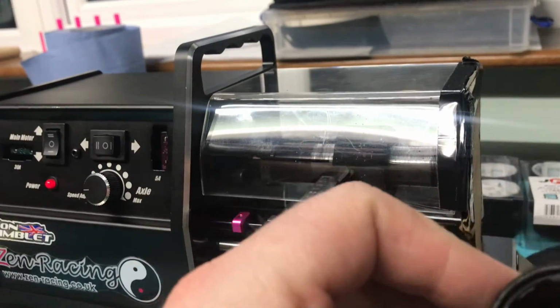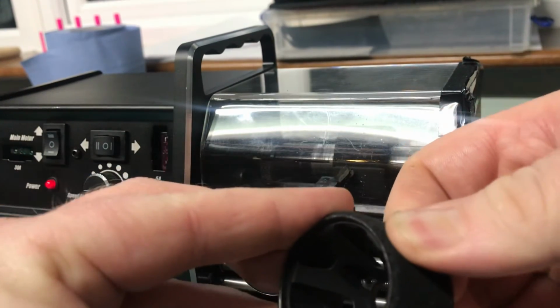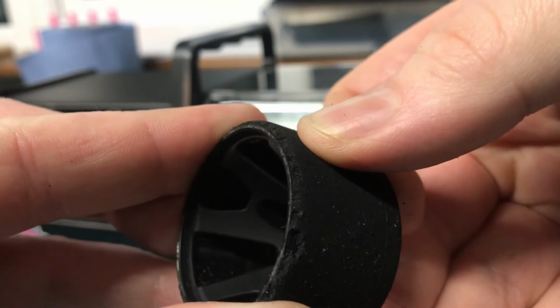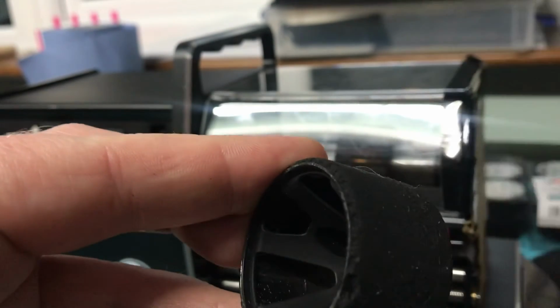So yeah, that's basically it. The only other thing I do, and these tyres are not the best example of that, is I check for peeling and any sort of chunks starting to form. Let's wait for that to finish. What happens is the edge of the tyre starts to peel back, and when you run it back, you can see it just here. If I bring that close, you see how it's peeling. So this tyre's pretty nibbled anyway, but that will develop into a chunk later.